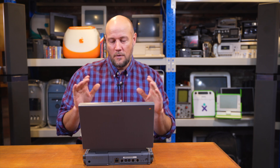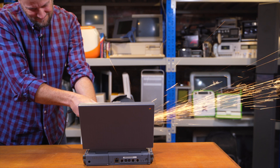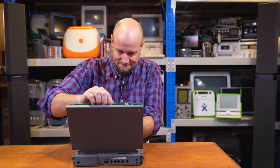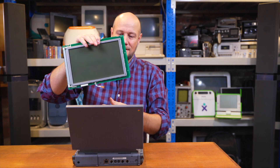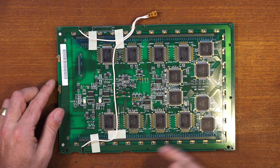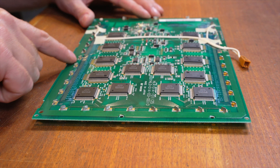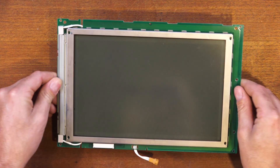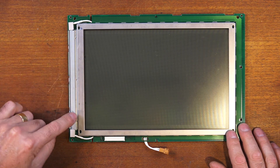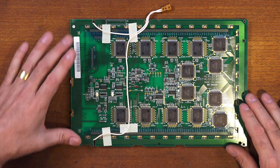Before we can bake this panel we need to get it out of the machine. I've done that on a previous video so I won't go through it again here, I'll just cut to a montage. Okay, we've got it removed. We want to get the LCD panel off of the circuit board. So here we have the LCD panel on the bench. You may remember in the last video these are all the clips that we tightened to try and eliminate the problem, which of course did nothing. So now we want to loosen all of these clips so that we can get that LCD panel off. I've noticed there's a backlight bulb here that may be attached, but we'll find that out as we go.